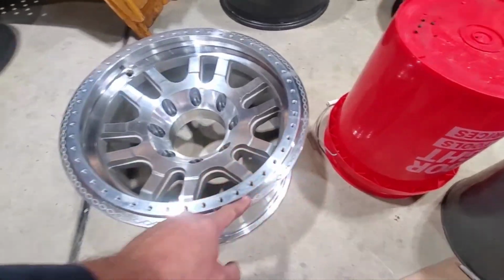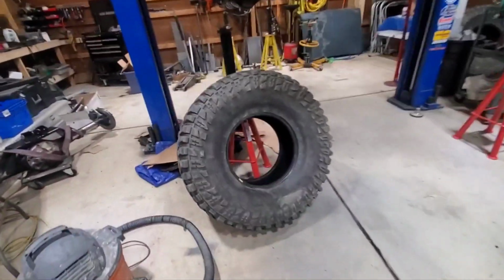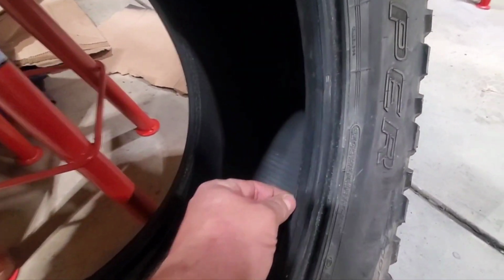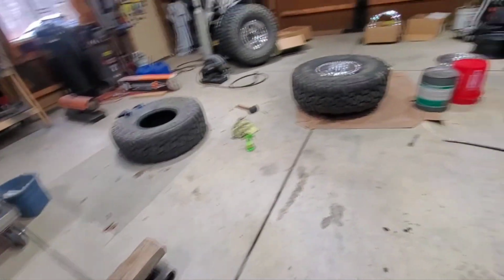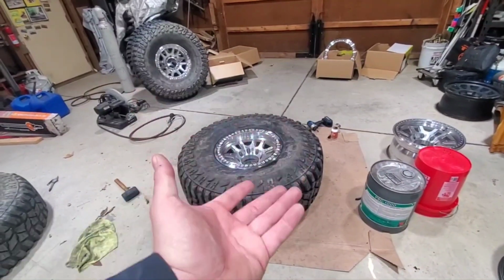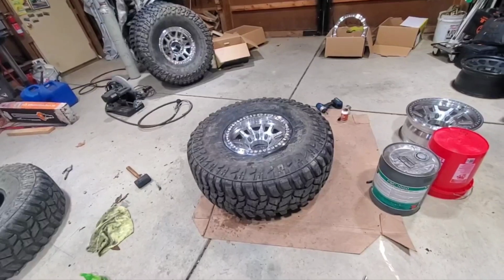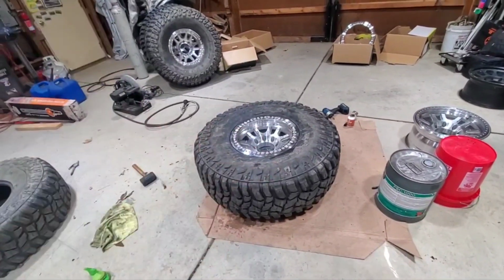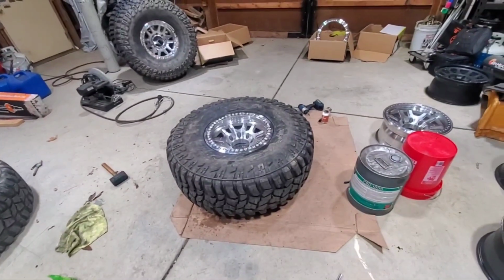along this lip. And the tire itself has a fairly sharp edge. This needs to be tucked down right inside that lip of the rim. So with the rear bead kind of forcing the front up, it's kind of a pain. But yeah, third tire, everything's going a lot smoother. A little bit of soap and water all the way around, slipped down a lot better.